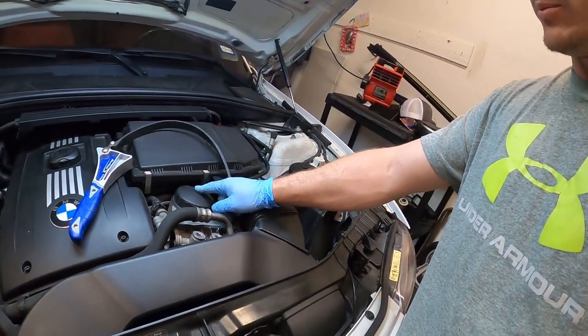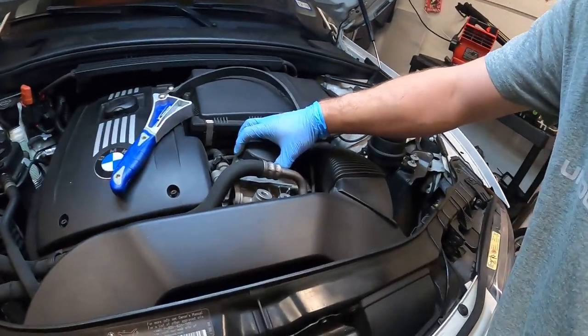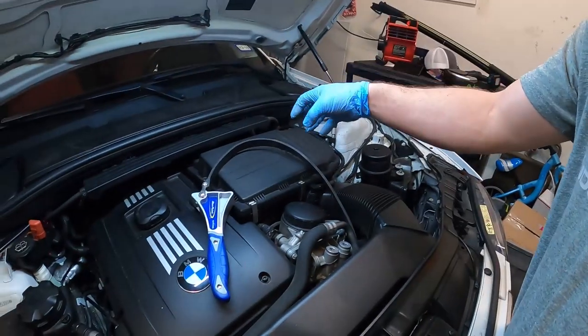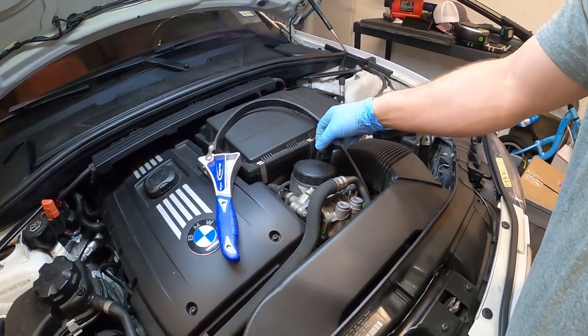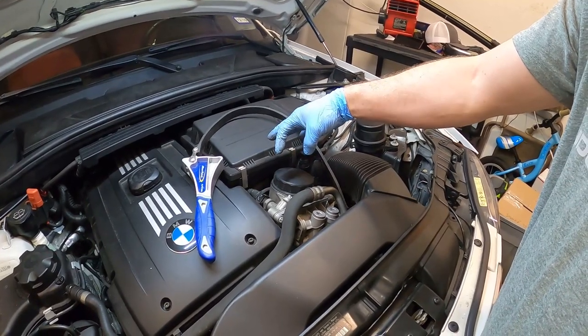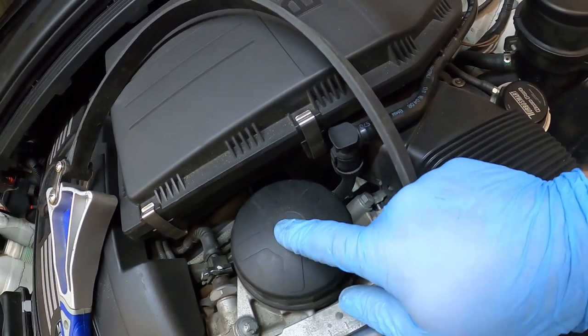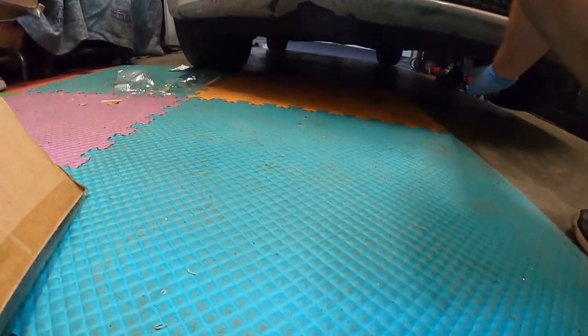What are you gonna need to change the oil on your BMW? A nice oil filter cap wrench — which I have, I'm too lazy to look for it. Essentially what that does is go on here — these little ribs on here. They come in 17, 19, or 22 millimeter, those are the common three sizes. Put your wrench or ratchet and socket on there and lefty-loosey, pull it off. Cool thing about the factory ones is the torque spec is actually stamped on there.